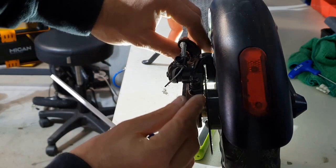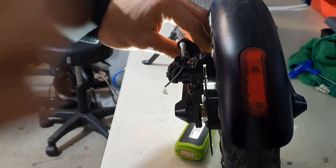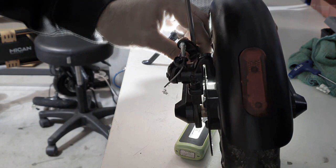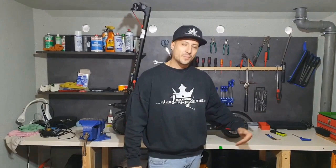Now we have the opportunity to align the brake caliper in a precise manner and examine it by measuring the distance using the light gap. Right and left should have approximately the identical distance to the brake disc. Next, proceed to reattach our brake caliper once again, ensuring it is securely fastened using the screws. Next, we inspect it. The brake would now be properly adjusted.